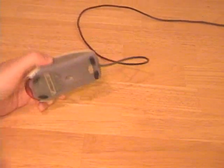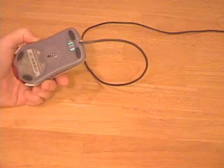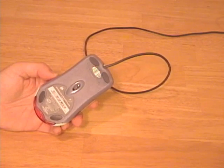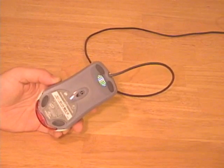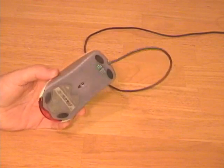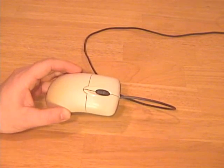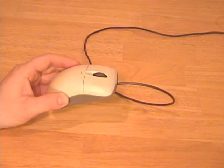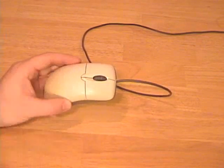If you use an optical mouse — the type that has an LED or laser light on the bottom — you can clean that LED light by using compressed air to spray away the dust and debris. You also have to clean the little pads, the same procedure as with a mechanical mouse. You can use a toothbrush to scrape around the pads, some warm water and a cotton swab, a cotton ball possibly, or you can dig down with a plastic toothpick. For cleaning the top and the scroll wheel, you can use a toothpick again, or a mild detergent. You don't want to get these things too wet, but you do want to keep them free of dust, debris, and the oil from your hand, so it's a good idea to wipe these down occasionally.